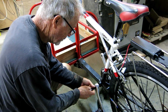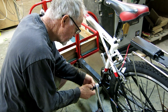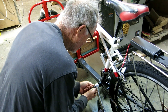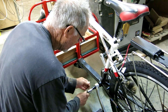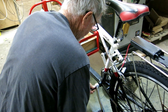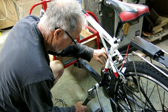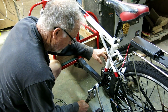This is the little ten dollar tool I didn't have when I was doing all my welding - you pretty much have to have it to pull aluminum cranks off the axle because they're forced on really tight. One end is a socket that fits the nut to remove it from the crank, the other end screws into threads in the crank, then a bolt in the middle tightens down like a gear puller but inside-out - pops the cranks off easy. If I'd had this while welding I probably wouldn't have messed up the bottom bracket bearings and saved myself $27.